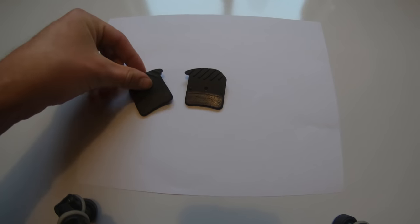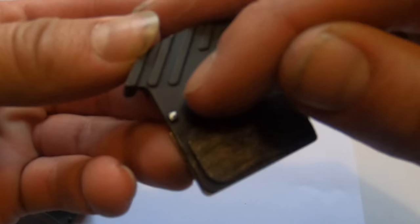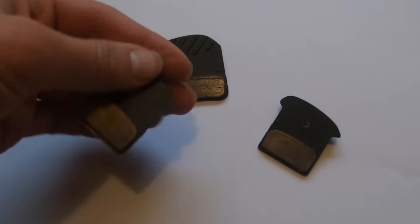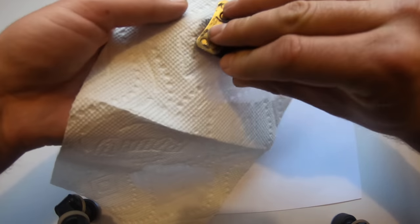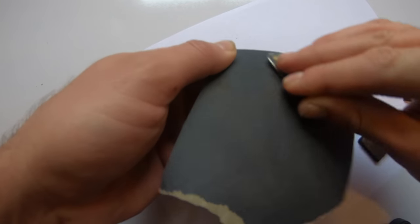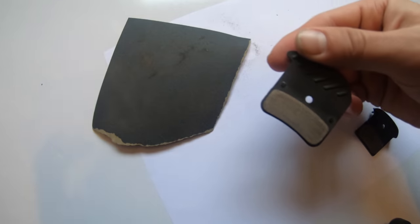Let's get started — you're going to need to remove those brake pads. Next, I'm going to inspect those pads. I noticed a clicking noise when I was running these, and this is actually from one of the pads being worn down too much. There's a little square thing above the pad that basically indicates you're running low on material and probably need to change them out. Now I'm going to kick this off by putting a little bit of alcohol on the paper towel as well as some alcohol on the brake pads, rubbing in a circular motion back and forth until all the dirt and grime is gone and the pads show that they're clean. The next step is to sand the clean pads with 220 sandpaper, using an unpredictable sanding motion — circular, up and down, side to side — until that glaze color leaves the pads.